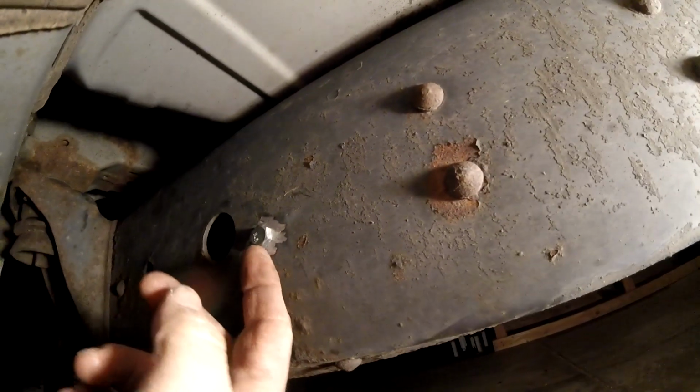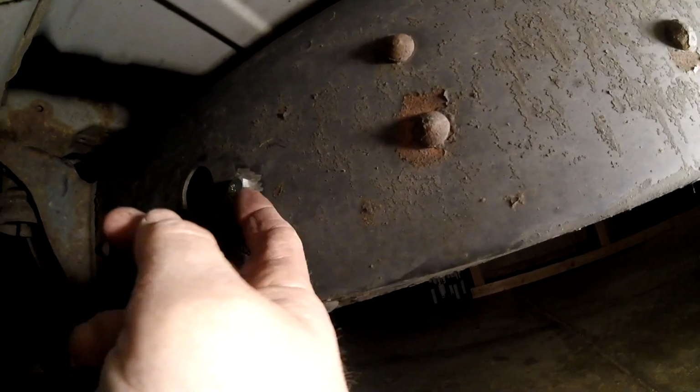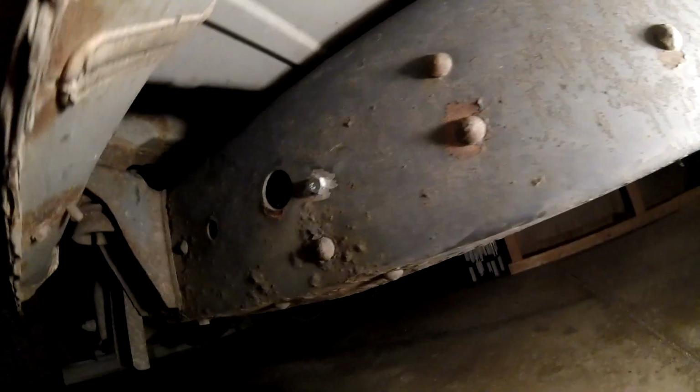And then I took the Dremel and I knocked all the rust off. Just knocked it all off there, made it nice and clean on both sides. I did it on both sides. A lot of you guys will just do one side and call it a day. No, get all the paint off on both sides. Get this light over here, I'll show you what I did. See how I did it on that side too? So that way the bolt is jammed up against that clean metal. Now, yes, it's going to rust all around that. Of course it is. You could go back and spray paint it if you cared. But the point is to have good metal contact on both sides of that joint. When it comes to a good ground, guys, you cannot have a good enough ground. You just can't.